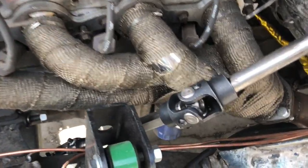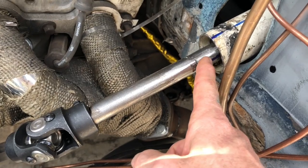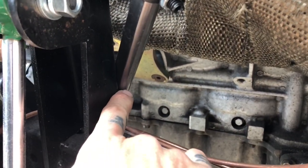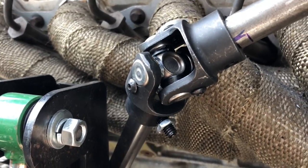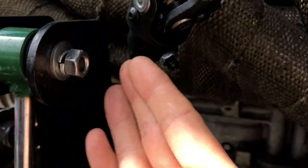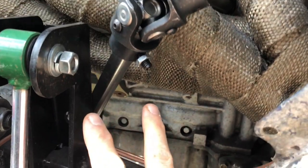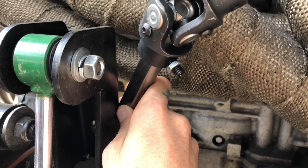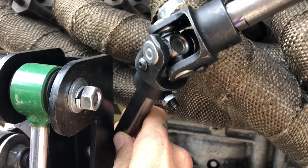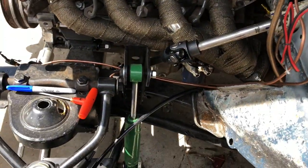The next step is I need to get my heim joint out here with my two lock collars. I've got another lock collar I'm going to put up here to keep this from moving around. Then I want to drill a hole in this and use that to mount the stabilizer heim that will keep this from moving around and hitting stuff. If you just turn it right now it's going to get all loosey goosey — once you go more than two U-joints, you have to have a stabilizing unit in there somewhere. So I have to space this off, maybe even notch this out and get that done.